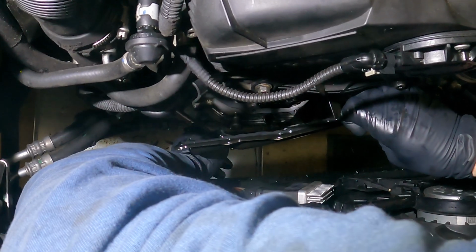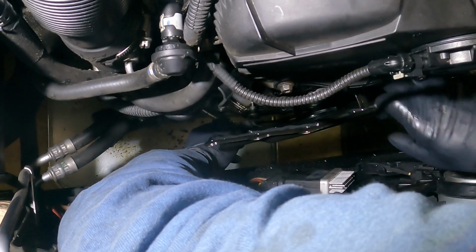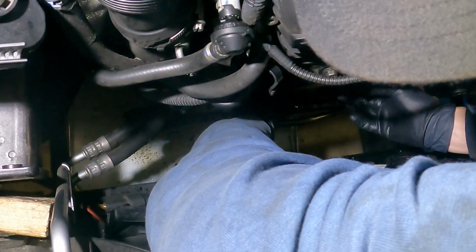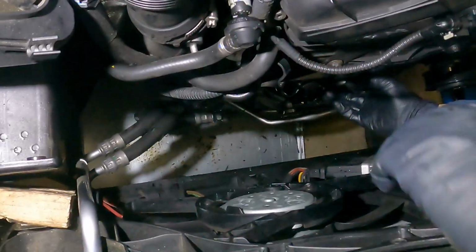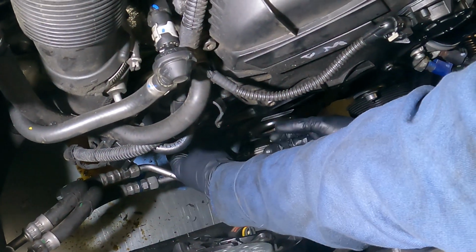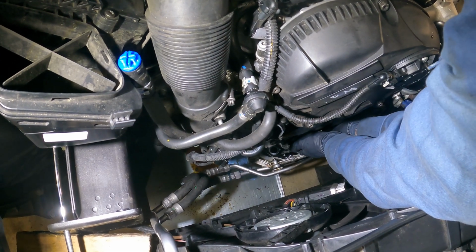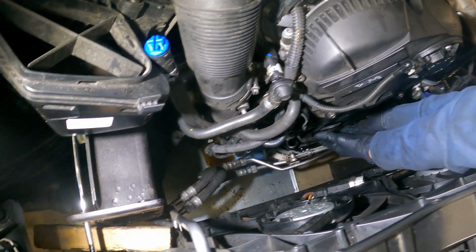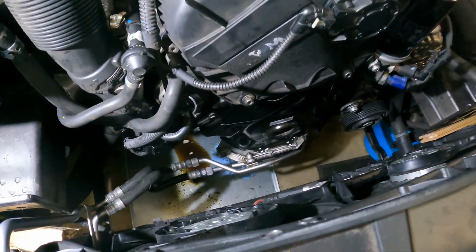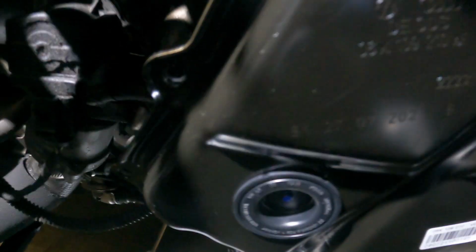So I guess the best bet is to just try to line up the dowels first. Careful of the tensioner. And it's really hard because you can't see. Just find the dowels with your fingers, and then slide it in. Once it's on the dowels, it kind of just pushes in. Give it a nice little gentle push. You don't want to push it too hard. And then come back through and double check all your holes are lined up. Just double check how it's looking.